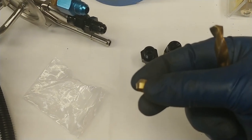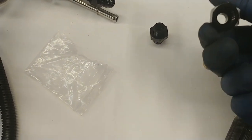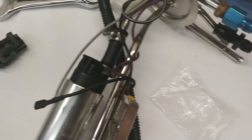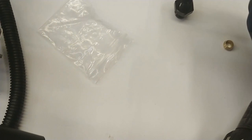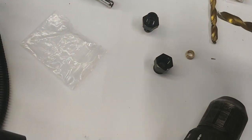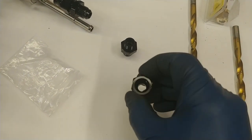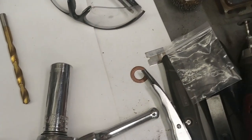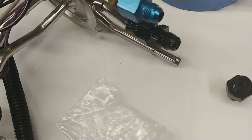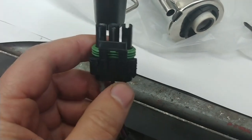Taking a closer look at this compression fitting - this is a collar that goes on after you put the sleeve on. A 5/16 bit will pass through there no problem, but it wouldn't go over the 5/16 return line. So I took the next size up, but it would not go through either. I went ahead and drilled that out, then used my Dremel with a sanding drum to clean it up the best I could, threaded it down, put a little compressed air on it, and I didn't hear anything leaking - I'll test it properly later.